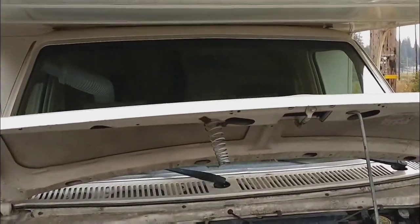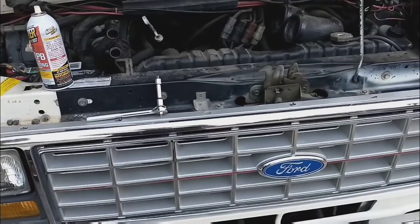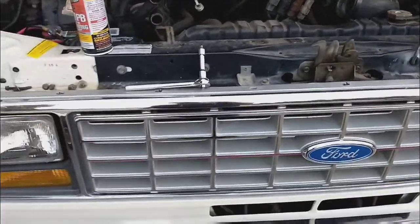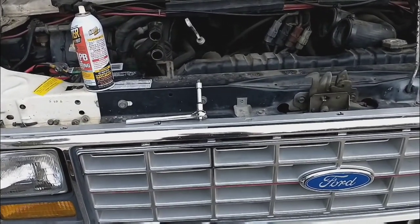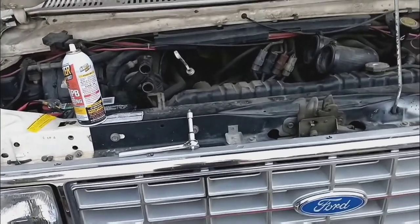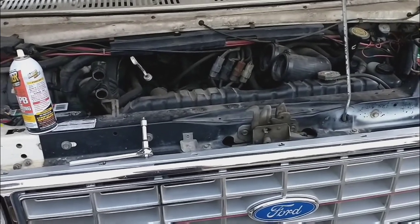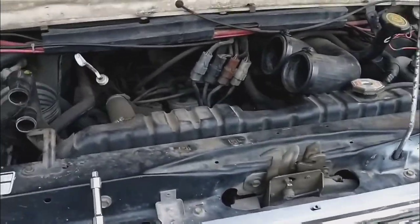I'm here with my motorhome, it's a Ford Econoline 350, 1989. I think most of the 80s models might be like this — it's got a 7.5 liter 460 engine in it. With my 1990 Chevy I had a smaller V8, and changing the belts was so easy — five minutes in an AutoZone parking lot. You just stick a ratchet into the tensioner, pull it to the side, and the belt pops off. With Ford, of course, they had a better way to do it.